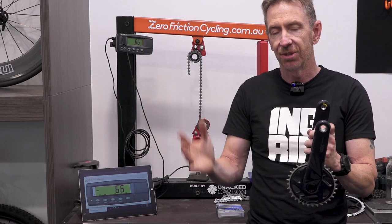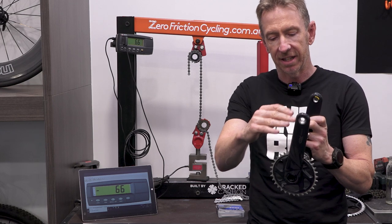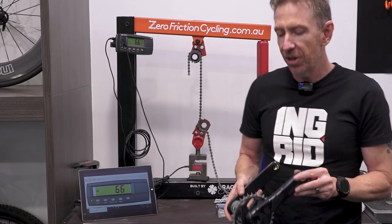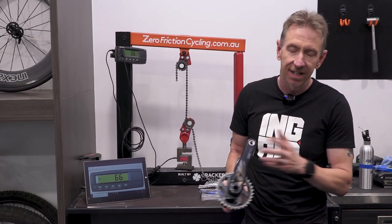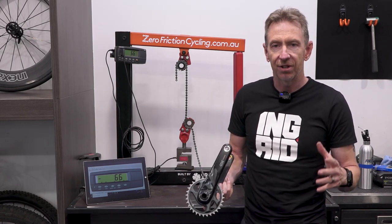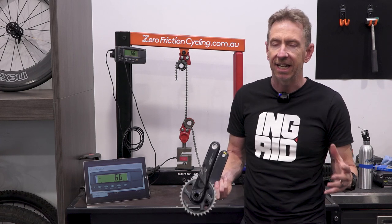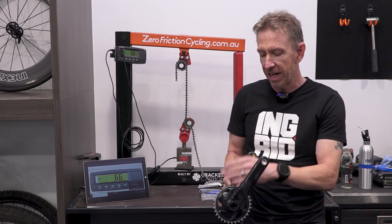And the tensions will be greater or smaller in your chain, depending on your chainring size and your lever length in relation to where that chainring finishes, and also how that changes with cadence. So that's why it's a pretty dynamic figure. I'd have to check, but if you're doing, say, about 1,000 watts, pretty decent power, at 100 cadence in your large chainring, I think from memory with a 53 tooth and a 175 crank, it calculated out to somewhere around 400 newtons of tension in the chain.